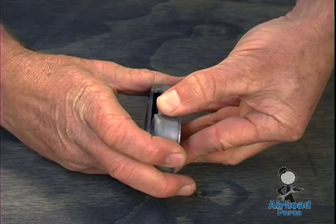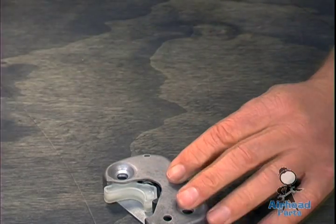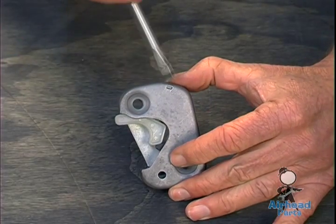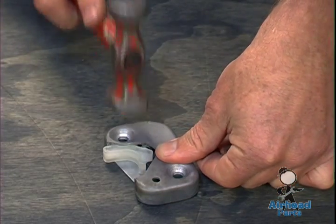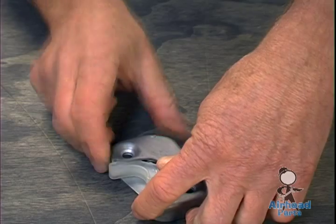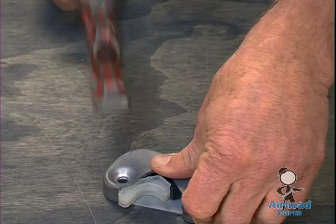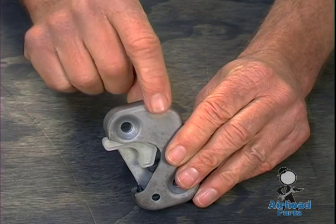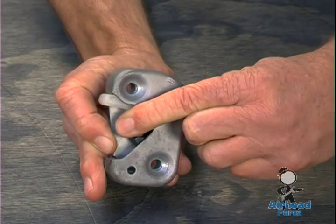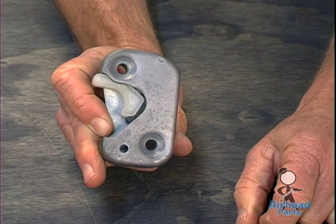You want to squeeze these two together evenly like that. Together, the little tang here — you can see it's slightly recessed now. We're going to tap this all the way around until it's good and together. Then the tang here gets tapped — just like that — flares out slightly, and you have a rebuilt striker. Ready for your weekend driving pleasure.